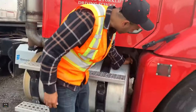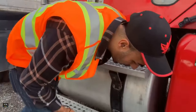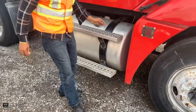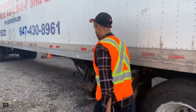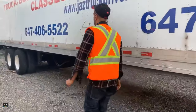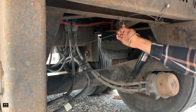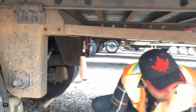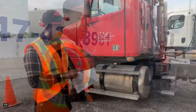I have another drain valve on the other side — I know it's the primary because I already checked the wet tank and secondary. I pull it and look underneath — no oil, no moisture, and the drain valve is working fine. If you have a trailer attached, you also have to drain the air tanks on the trailer. I pull the trailer drain valve — it's working and there's no oil or moisture. That completes the drain the air tanks step.